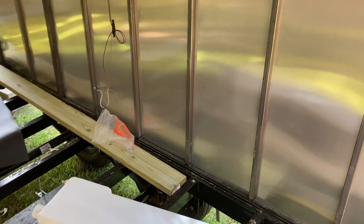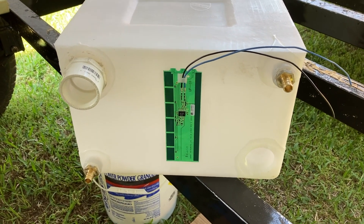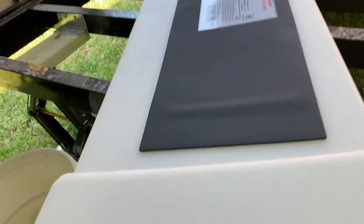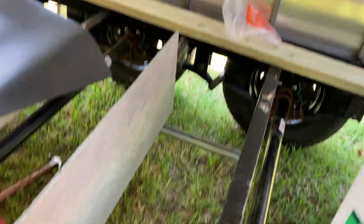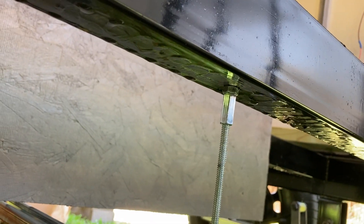Each tank gets set below the floor here in the trailer. Here is an electronic leveling strip that measures the height of the water in the tank. A lot of people don't do this, but I've also put a heater on the bottom of each tank in case it's ever in really cold weather. Here's how the setup works with the unistrut and this quarter-inch bolt that goes through the frame and then uses a coupler-type nut — it comes down through the frame and into the unistrut.